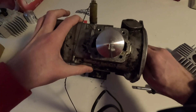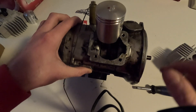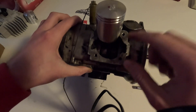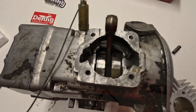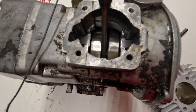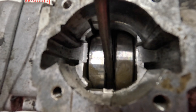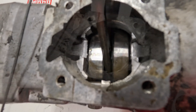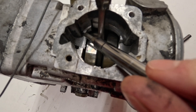So if you're having this problem, this video can be helpful for you. This is just on the ZA-50 engine and just on some of them. We're going to take a look inside — the little corner tabs they sometimes hit on, but that big bottom tab in the bottom middle is what it usually hits on, and you can just break that out. I'd put some Play-Doh or a towel in down there to break it out.